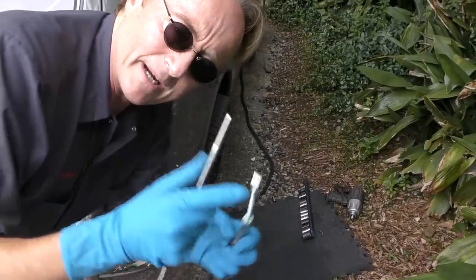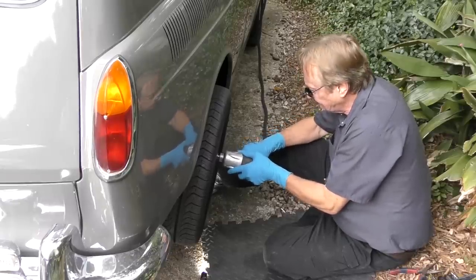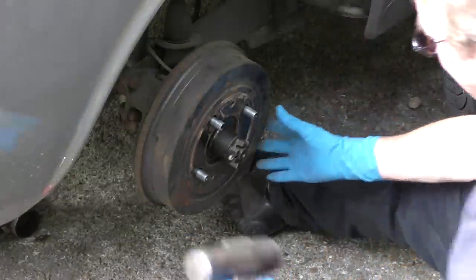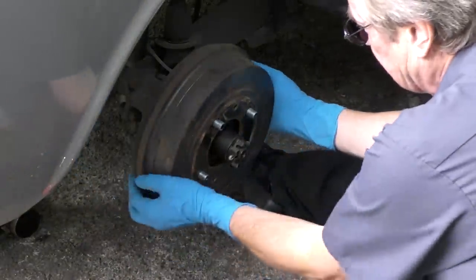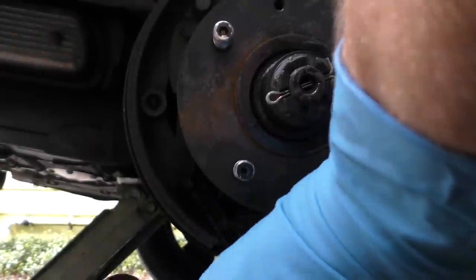So we've got the cable. We have to take off the tire on the back — this is the side that's broken. Off it comes. Take the bolts off that hold the drum on, then whack it and off it comes. Now since the cable here is broken, we'll just pull it off and cut this end off with a grinder so we can get the old one off.